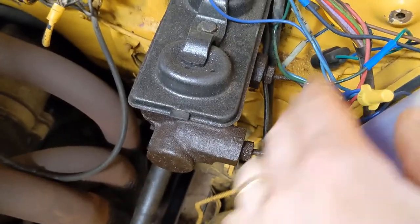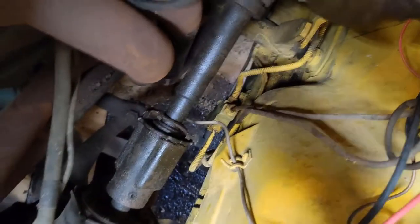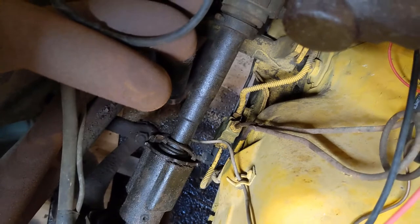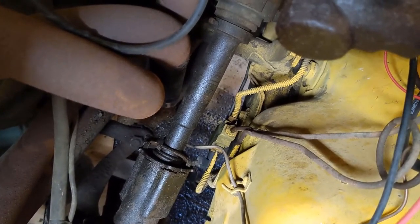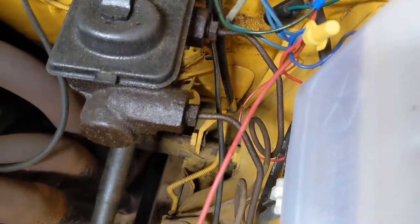In order to swap these, we're going to have to take off these brake lines. My experience is that these brake lines, especially on something this old, are usually pretty brittle. They also tend to be rusted together. So go into this assuming that you're going to have to replace them. You'll probably twist off the ends or round off the nuts. If you don't, consider it a win.